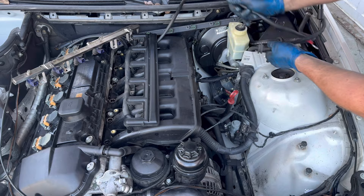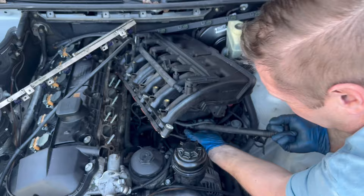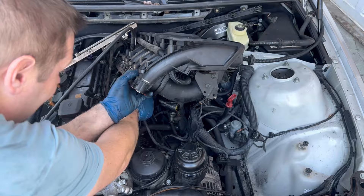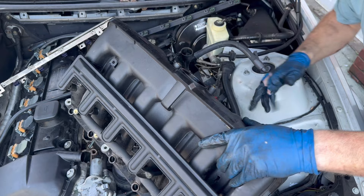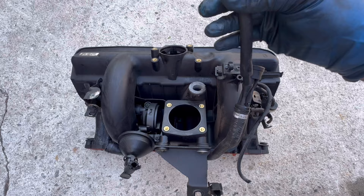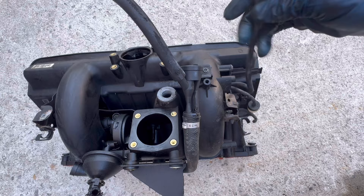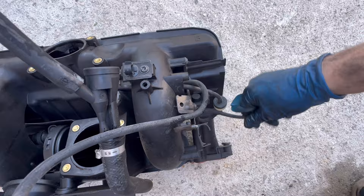The CCV line just melted in my hands as I tried to disconnect it — so again, good thing we're doing this. It's a whole lot of 'while you're in there,' but it's really going to set this car up to be reliable. There's a vacuum line here from the purge valve — got that. Finally, liberation. You've got your CCV here — this line just rotted off. Here's the jet suction pump we've got to replace. There's some vacuum line — this one goes down to a canister for the muffler flap, and this is the check valve for the SAP.